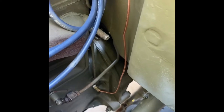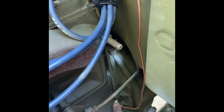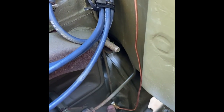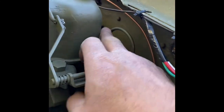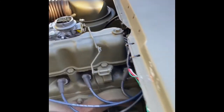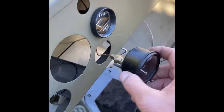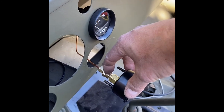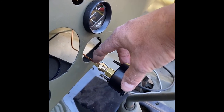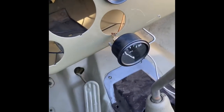I just go with these copper ones. You can get them on Amazon, on eBay, you can get them anywhere — auto parts stores have them. Again, the fitting from the package goes right into the block. You plumb it in however you want it to go through the firewall. You get through to the gauge — there's your Wheelies gauge. There's the hardware from the kit you got from the auto parts store, and then there's your Missing Link. And with that, you are in business.